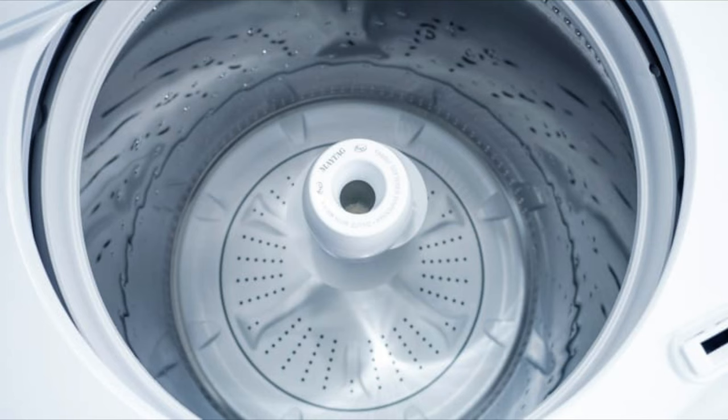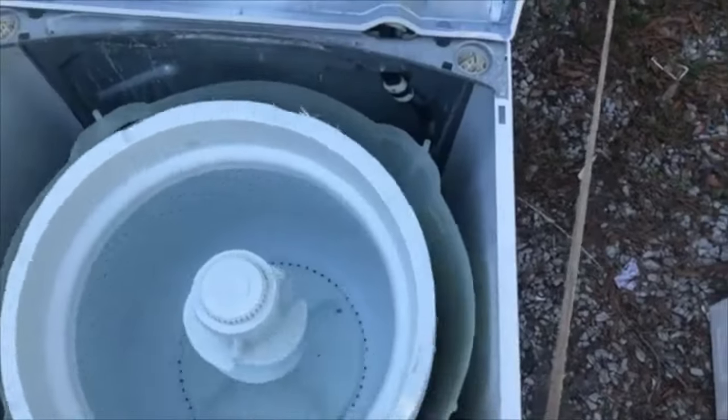I've worked on both of these machines and they are both made by Whirlpool. When you strip away the exterior, they both pretty much have the same identical parts, interchangeable enough to be swapped. The Whirlpool has a porcelain-coated but smaller tub, while the Maytag has the shiny metal tub. If you want to spend a little more for the Maytag name and the shiny tub, then choose the Maytag. Otherwise, save your money and take the Whirlpool — they're basically the same washing machine. Both of these washing machines tend to have suspension rods that will fail after a few years of service. Once these rods fail and you get an out-of-balance condition, continued use will almost certainly cause damage that cannot be corrected. So if it starts to bang and get out of balance, get it fixed before you use it again.